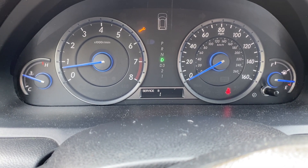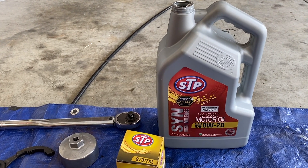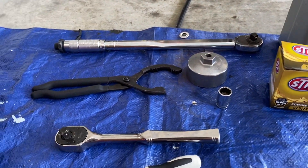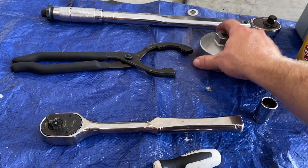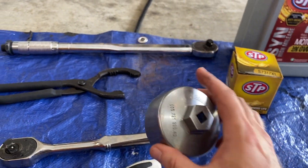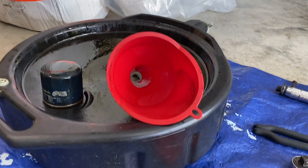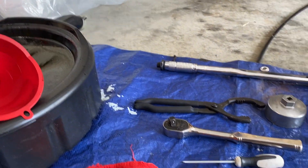The car has a service reminder saying B1 negative 161. All we need for an oil change on a 2010 Honda Crosstour is four and a half quarts of motor oil — they call for 0W20 — and a filter from STP. I'll put links in the description. You'll need a 17 millimeter socket, a ratchet, a torque wrench, and a tool to remove the oil filter. We also have an adjustable filter wrench. Put a tarp under the car in case oil splashes, a catch can for the oil, and a funnel. That's all you need.